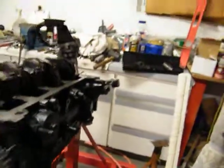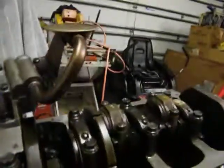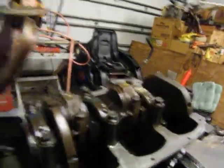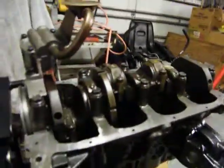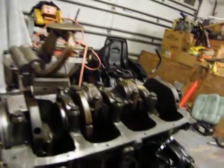Put the covers and stuff on it, get everything ready, get the water pump on, get this piece right here on. All of the sending units should be coming in, so these old ones will come out and I'll be able to put the new ones in. But the longer it sits it's just got very little assembly lube on it. I use a lot of blaster on the cylinder walls, and you can see it leaked through them — which ain't bad, that's par for the course.